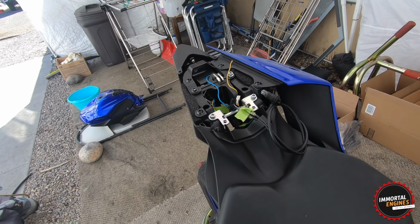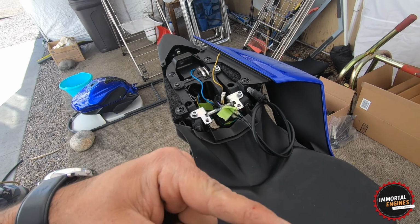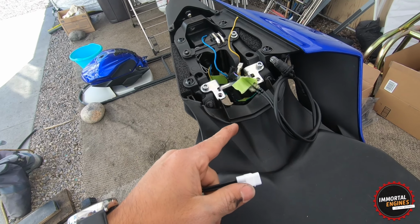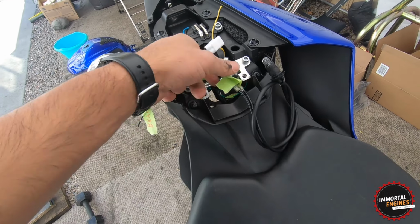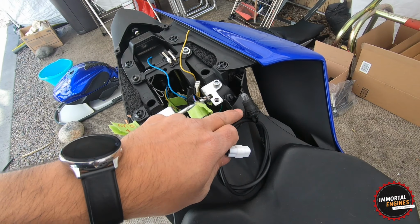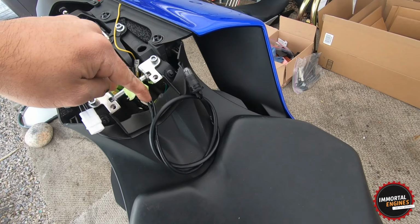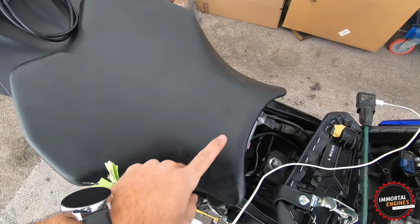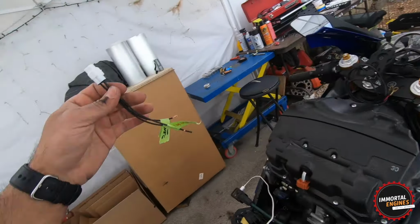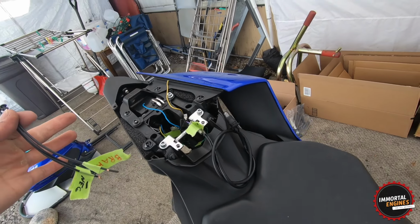Okay guys, so for the daylight running lights, I know it's a little bit crazy, but I'm gonna be wiring from the front all the way to the back, because I only need a positive and negative that's connected to the clearance lights of the bike, and the plugs back here on the tail of the bike that are supposed to be for the OEM license plate light. I have this wiring that came with the blue fairings, but it's perfect because it has the plugs. It's probably about this long, and I just got a wire from here following the frame all the way through the front. Luckily, we're using a circuit that already has a fuse, so everything's gonna be safe. If something is not right, the fuse is just gonna blow.